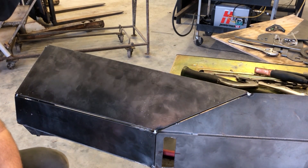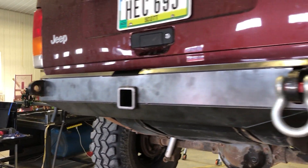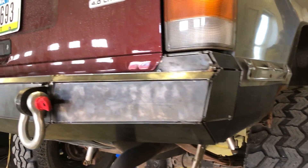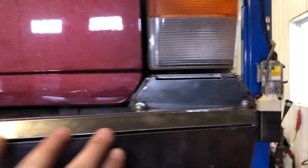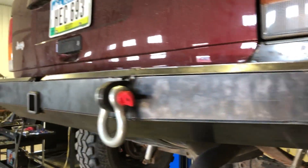That's the right side, guys. Let's go stick it on the Jeep and see what it looks like. You guys ready to see this? Okay, let's take a look. Oh man, this is turning out way better than I expected. I've had some issues with the tabs being too thick and having too much of a gap in some areas, but after a little bit of fitting it fits pretty well. We're following this edge, that seam pretty well. There's like a three-eighths to a quarter-inch gap across that.